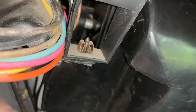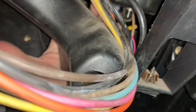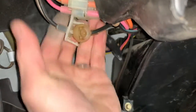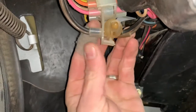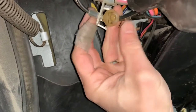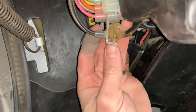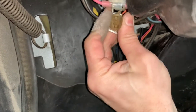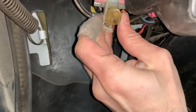You can reach your hand up in here, and behind this box where my fingers are, there is a fastener you can remove to take out this whole assembly. The issue you'd be having is this brown and black hose — it comes disconnected regularly. When it disconnects, air does not go into the vents that hit your face or body, and it can affect the other vents as well.